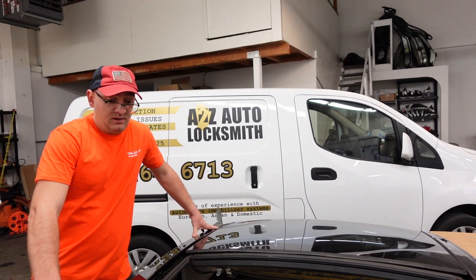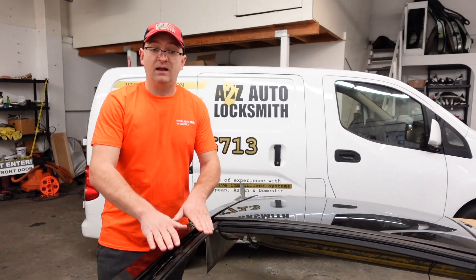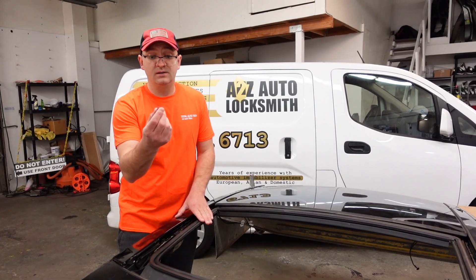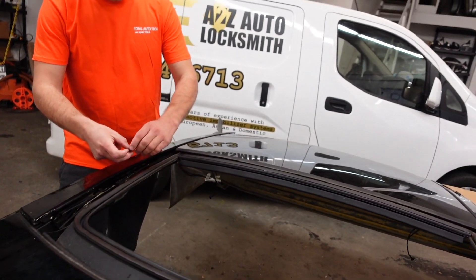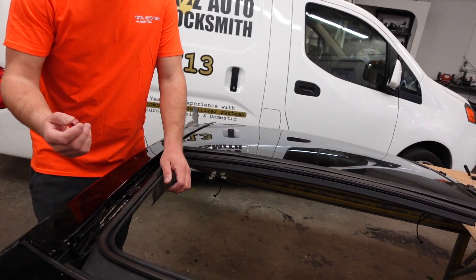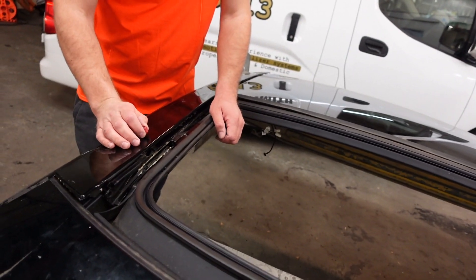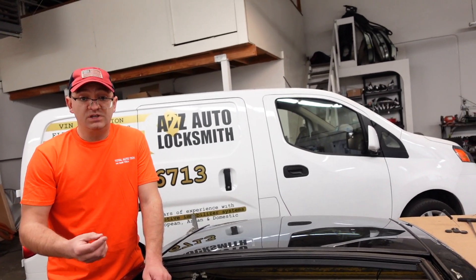What kind of things break? Let's discuss that. Sometimes your roof gets stuck and you can't open it. There are a few reasons why that may happen. You may have a problem with a shoe like this — that's a pretty small shoe. You can get them from Tesla. They're actually sliding on the rail. Why can they get stuck? Well, there could be dirt, there could be some objects, something may be in there. So that needs to be inspected, checked, and fixed if that's a problem. In some cases, the shoe is basically worn out and just needs to be replaced.